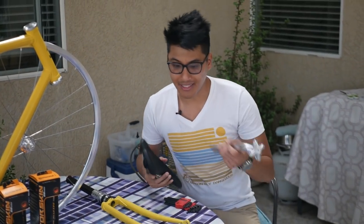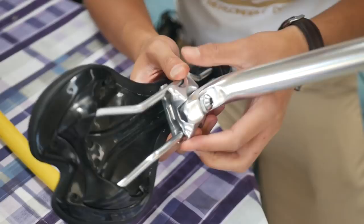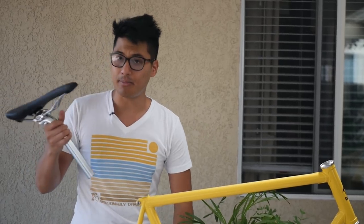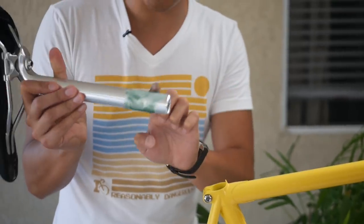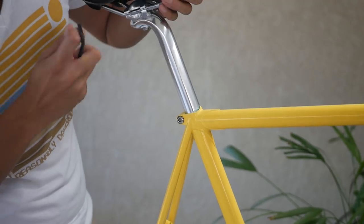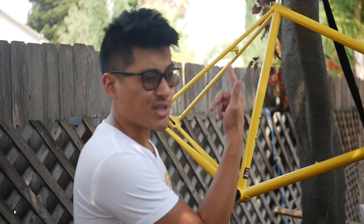The first thing I like to do when building a bike is to put the saddle on the seatpost — you'll see why very soon. Put it on the clamp and tighten it. It doesn't really matter where it's positioned; we're not doing fit right now. Now that we have the saddle on the seatpost, the next thing is to put the seatpost in. It's important to grease the seatpost. If you don't, it could seize up and get stuck, and you could ruin a frameset. Get some grease inside the seat tube too, loosen up the seat collar, slide in the seatpost to the minimum insertion mark, and wipe off the excess grease. I put the saddle and seatpost in first because it makes it a lot easier to work on the bike — I use a tree since I'm too cheap to buy a $200 Park Tool stand.